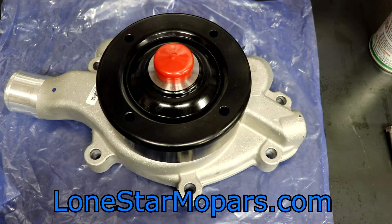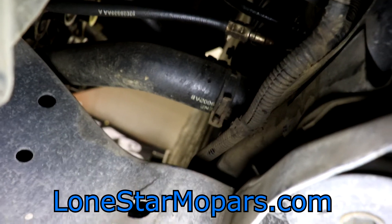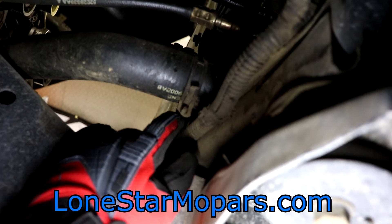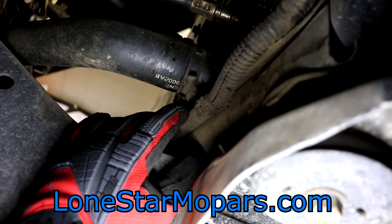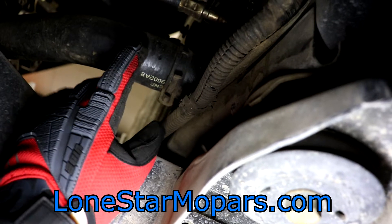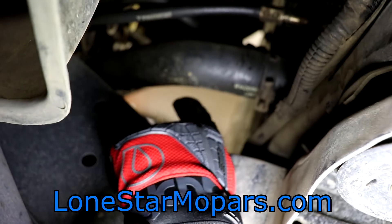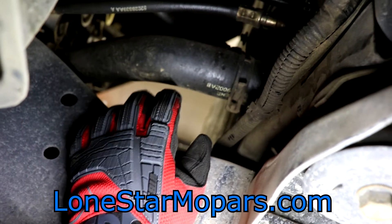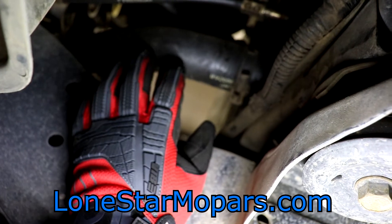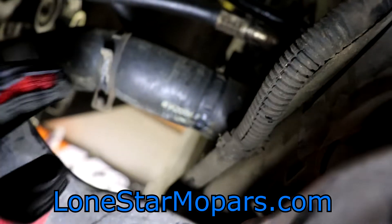Hopefully that showcases the method for you. I did pull the air hammer and had it ready — figured I'd fire up the compressor Saturday morning and just bust it off — but didn't have to. 5/16 bolts: start with two-inch, if you have trouble passing it through drop to inch-and-three-quarter. Inch-and-a-half — I made many attempts and just could not get them to work. To confirm, using the handy gauge: five-sixteenths, and on the length exactly two inches.